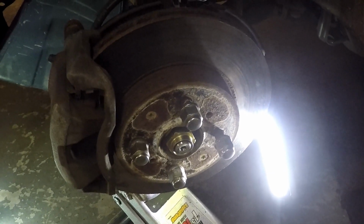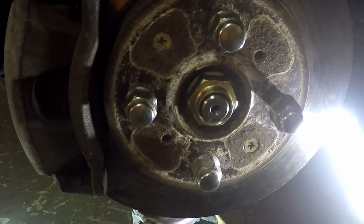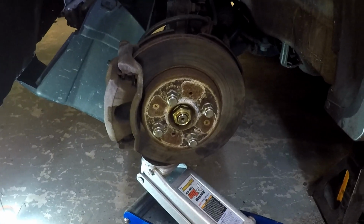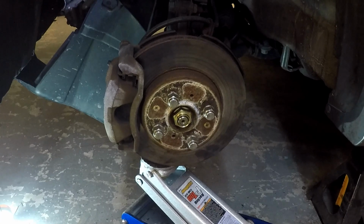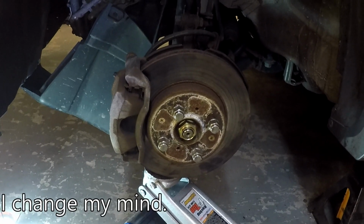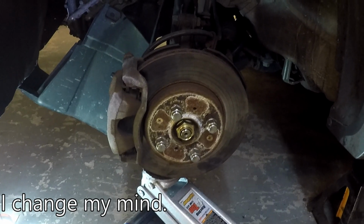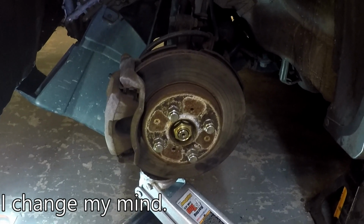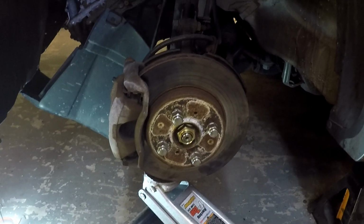And now I'm going to torque down the nut right there, axle nut, and then stake it. Unfortunately, the spec calls for 133 foot-pounds. I don't have a torque wrench that big. I didn't really consider that. So in light of that, I am not going to do the passenger side because I don't want to risk anything, and it doesn't appear to be in bad shape over there. I'm going to try to inspect it a little bit better because it does have that same little rubber flange.